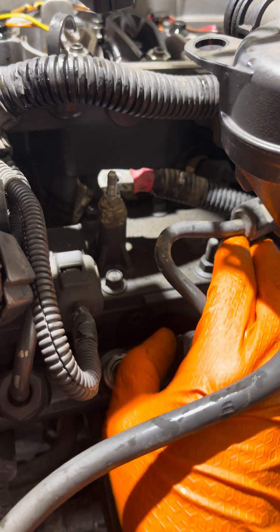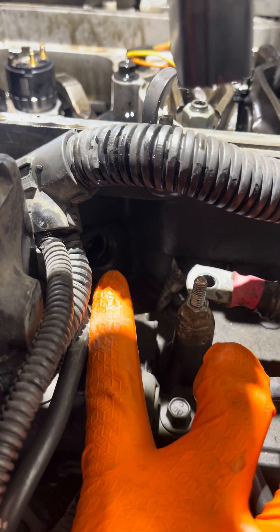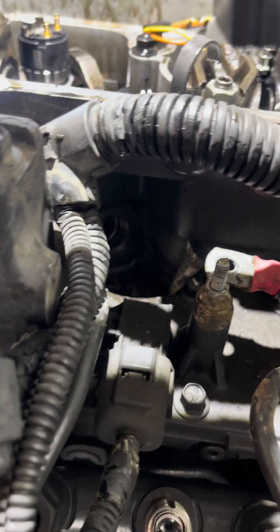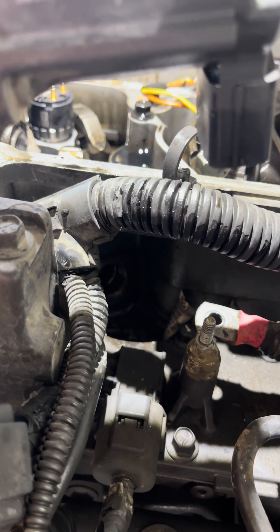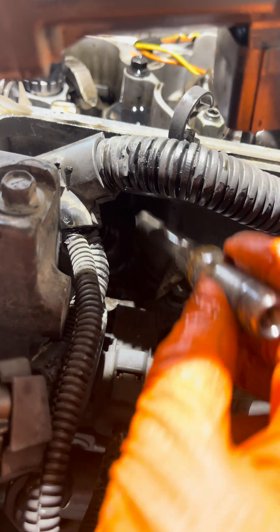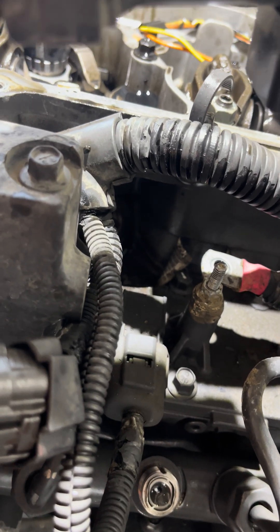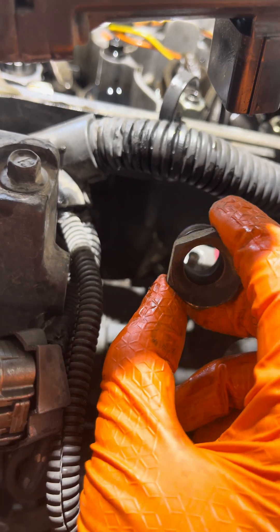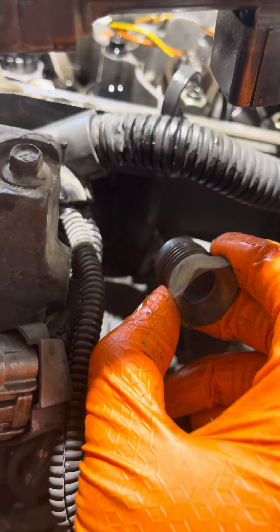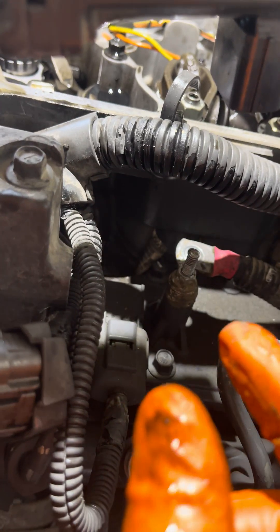Remove this plug — in order to remove the support plug for the fuel line, you'll see it right there, it just pops out. As soon as you remove this nut — this is a 24 millimeter — just unscrew it, and then you can just pry it out.